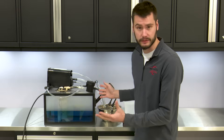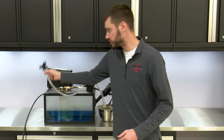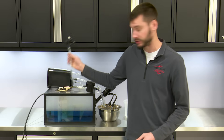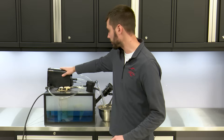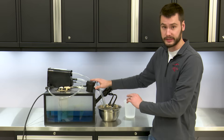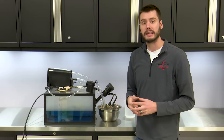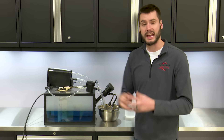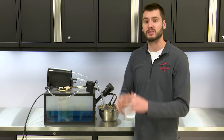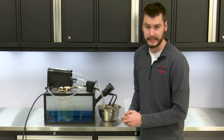This right here is a very condensed version of an evaporative emission system. We have our gas tank, our filler neck, our purge solenoid — this is the normally closed solenoid that mounts under the hood — our charcoal canister, which basically acts as a filter within the system, and then our vent solenoid. This is the normally open solenoid, typically under the back of the vehicle near the gas tank. It allows the air trapped inside the gas tank to be expelled out of the EVAP system as you're dumping fuel into it.